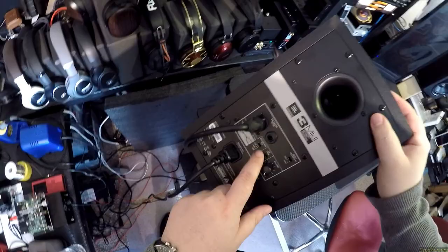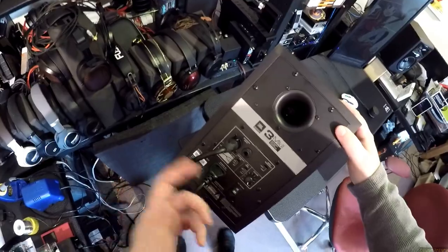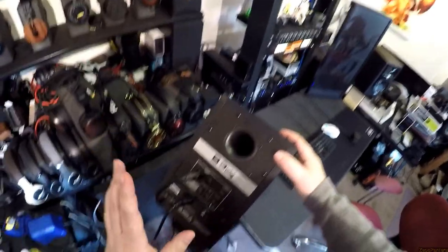We also get a high frequency trim, -2, which is on currently. I have to point out that in this configuration, I have it trimmed -2 decibels off the high frequencies. But the boundary EQ, which is basically low end, has 0, -1.5, or -3, and I have the bass all the way up. We'll get to how they sound.